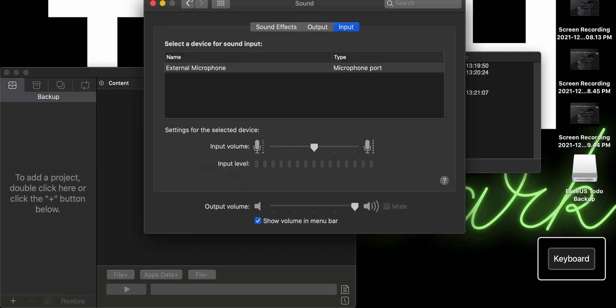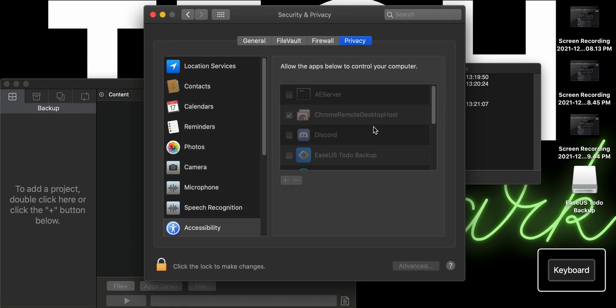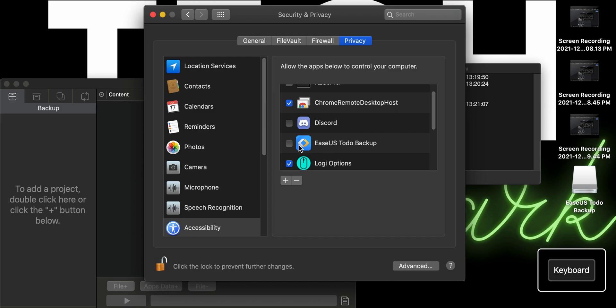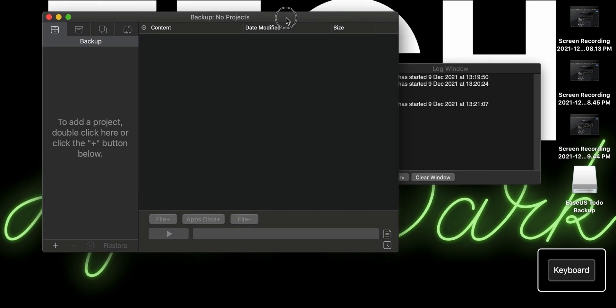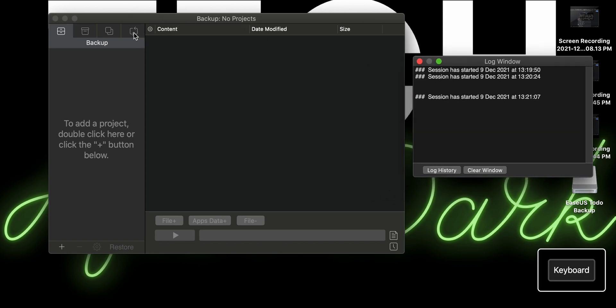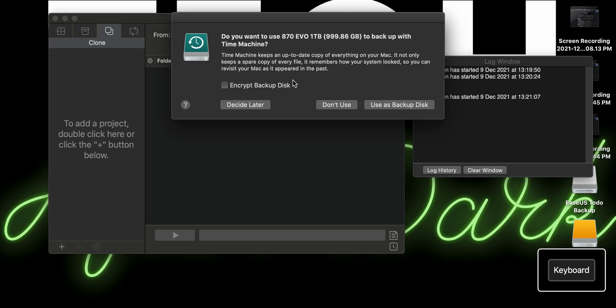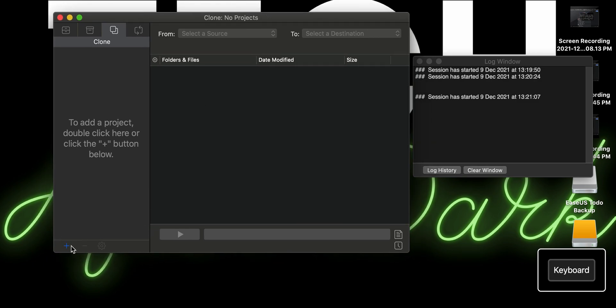Open System Preferences, scroll down, click the lock button, and enter your passcode. Click on EaseUS and then lock it back up and close that. Now here is our backup interface. From here we can go to Clone, and we can plug in the Samsung 870 EVO — this is the one terabyte. Plug it in, the light will turn on, and it's reading. If asked about using it for Time Machine backup, select decide later.